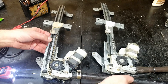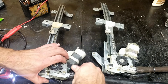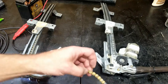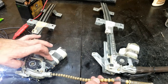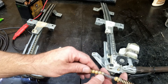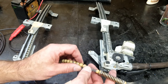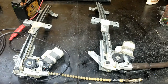I've messed with this regulator quite a bit. You can see I swapped out the sheathing where the beads travel as the window comes down, thinking that maybe it was gummed up and preventing easy movement — that didn't make much difference. The beads basically act like a chain and this is the sprocket. The motor is attached to the sprocket, it turns the beads, and there's a little spring action so that if it tries to go too far in either direction, it can compress the spring. This one had some beads break, and I made an attempt at keeping tension on the beads, which kind of worked for a little while, but I got tired of messing with it, so the idea is to replace it.